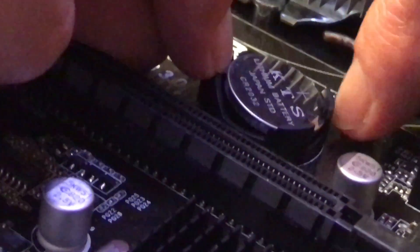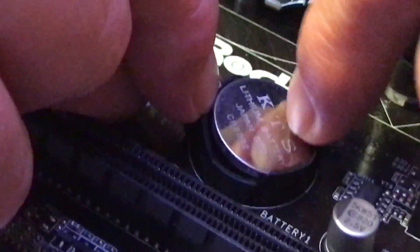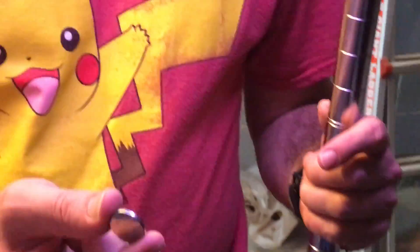It's already coming up as I do that. It came out — and I pushed it back in accidentally. Let me redo this. When I did this earlier it went out easily. I pushed down on that side as I was pulling the clip, then pushed down on the opposite side, and notice it's coming up — and that's your CMOS battery out.